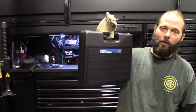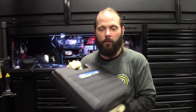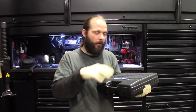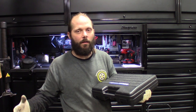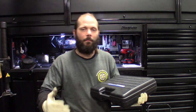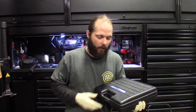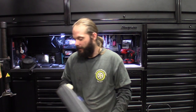So that's the manual AC hose crimper when you're making custom hoses. This is the manual one — they do have a hydraulic one. I'll put the hydraulic one and links to this one down in the description. This tool is not for everybody — mostly making custom lines. They do have other crimpers for smaller lines, or you could use smaller dies, same apparatus that you mount in the vise. Could I have spent an extra 40-50 bucks and got the hydraulic one? Yeah. But for what it is, I'd rather save the 40 bucks. Most of the time when you already got the hose on the car, you could find something to mount it to. For what it is, I think 148 bucks on Amazon is a great little buy — comes with all the dies, blow molded case, all that stuff. So if the next job comes along and we got to make some custom hoses, we got the piece for it. Quick tools in action for you guys. Remember, like, comment, subscribe — if you haven't already, we'll catch you in the next one.